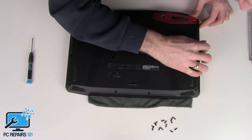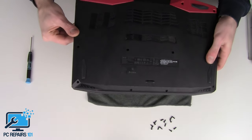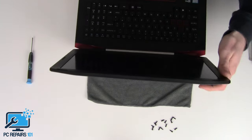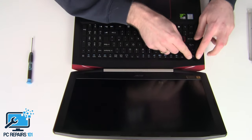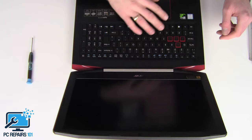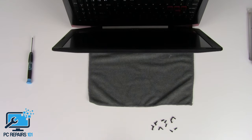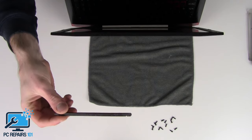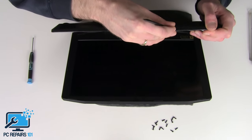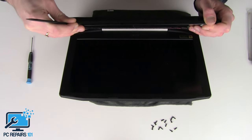So I'll just pop them off and have a look. You can see around here that's where the lid comes off. I'm just going to check the keyboard to make sure. Sometimes you've got little clips on the keyboards where you pop the keyboard off and then unscrew the screws on the palm rest, but on this one it looks like it's all one assembly. So I'll get my little pry tool — you can get these online, they usually come with free kits with iPhone repairs, etc.